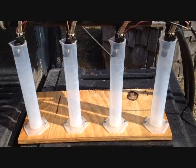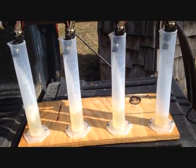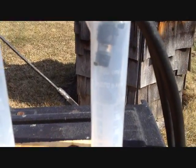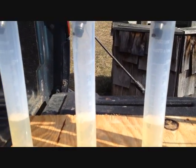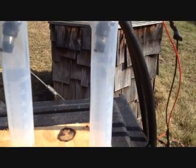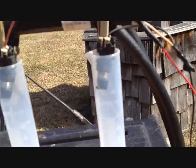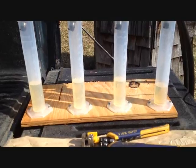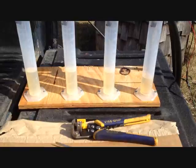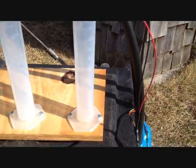Ready? Let's go. That guy's still leaking — that guy's junk, it's stuck, must have dirt or something on it. So those three again are around 40: looks like two 44s and a 43, and that guy's just leaking at about 25 something. You can see it's still spraying a little bit. You can see the flow difference. I'm going to empty all these out and do a dynamic flow to show you guys what we got. Back at it — you can see this guy that somewhat works is still leaking, so that one's going to be off, but I'll be able to show you the other three.